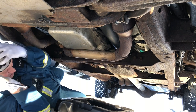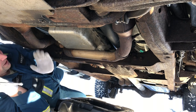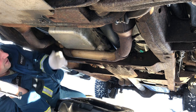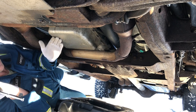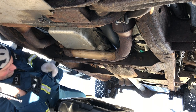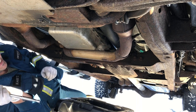We're just gonna drop the fluid, replace the filter, and top her back up to see how she goes. As you can see, the driver side exhaust runs right underneath the transmission pan, so that's convenient. Stick around to the end of the video — I'm probably gonna mess this up. We're gonna install a B&M drain plug so that next time we do this we can just pop the plug and drain the fluid out.